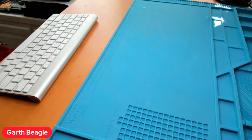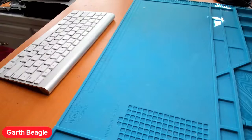I'm checking first to see, because it was so clean and nice, if it at least turns on. And partially I'm also testing the power supply. That row of caps right by the battery is going to be the culprit for the startup circuit. Perfect, because that is the biggest problem that I had. In fact, you could watch hours and hours of me cursing at the thing on a live stream years ago.